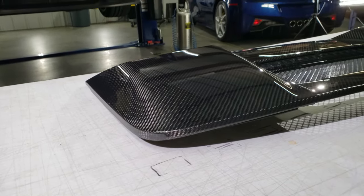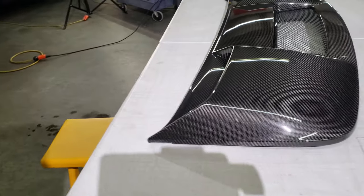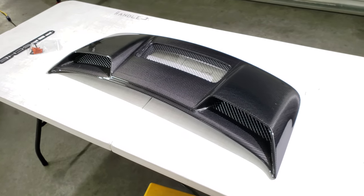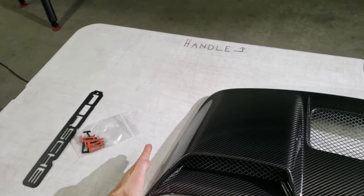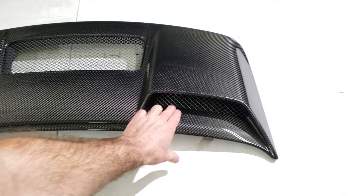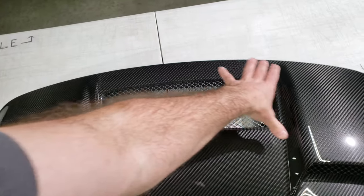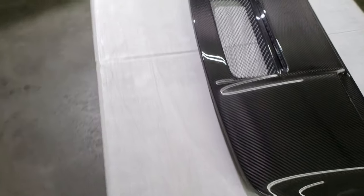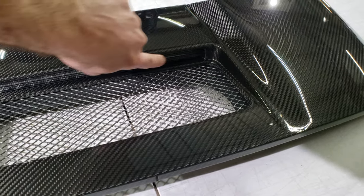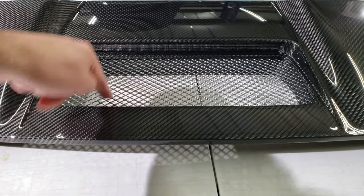You can see the film was wrapped all the way to the edge — one piece, that's how we did it. I'll explain how we wrapped it a little bit without giving up all the secrets of the trade. It's one piece all the way across. There is a relief that starts here and goes back, which allows us to tab it in, and then all of these edges are wrapped as well. There's a relief right through here and right through here, but this is wrapped over the edge and all the way down to the bottom edge.